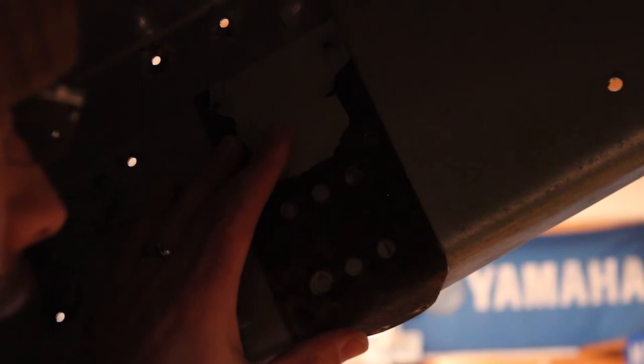Alright, so I've got my 30 inch line there, and I want to center that line in the middle of the rear hole right here, because I measured off the rear hole on the front there. Alright, that should give me enough to go off of there. What I'm probably going to do is I'll just drill out the rivet holes, rivet it in place, and then once it's kind of secure, then I'll go ahead and drill out the mounting holes on the bottom. I think it'll just work a little bit better that way to have everything held in place before I go nuts drilling holes.